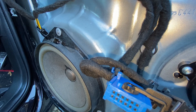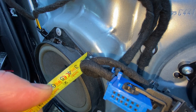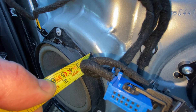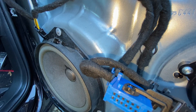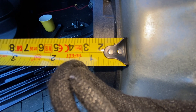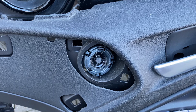The next thing is depth. Just off the front of the door card, if I put my head right to the side of the door, it's actually about 22mm deep. From this point to the very front of this face is 22mm. I'll move the camera so you can see it as well. There we go - going right in with the tape measure, you can see we've got about 22mm in that depth.